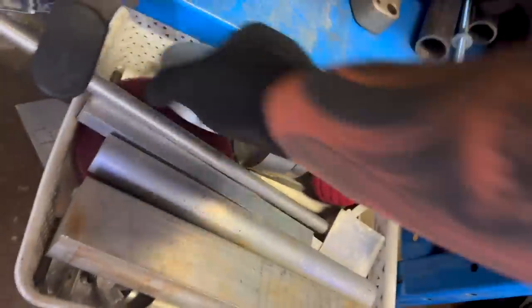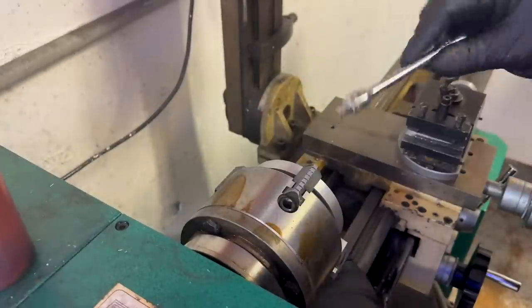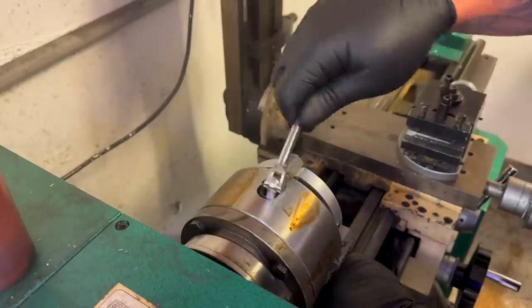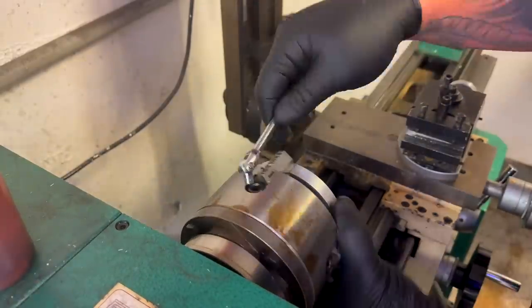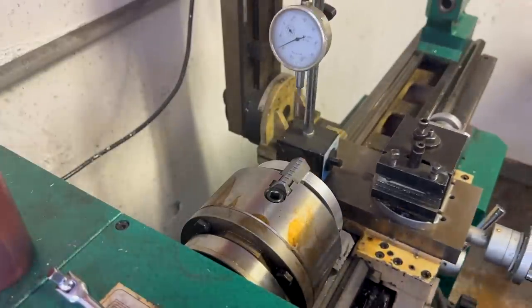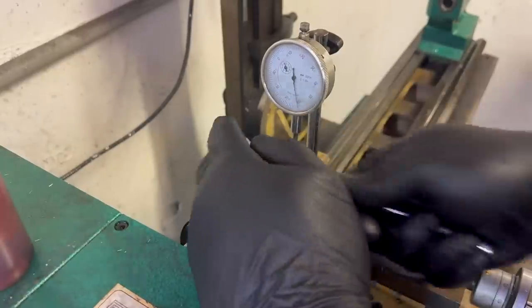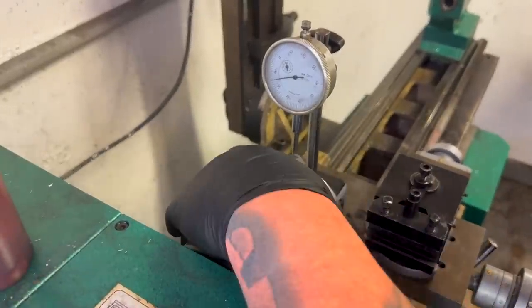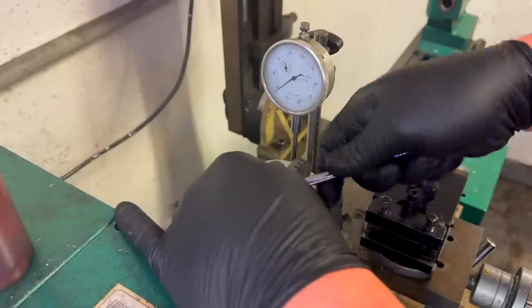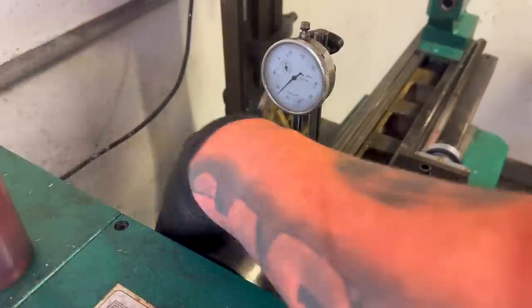What we're doing here is, because we went dry sump, I need to cover up the oil filter side of the block. So I'm sure somebody makes a really nice piece to bolt in there, but I finished the short block and I had a little extra time. Plus I like making things. So I found a 3 3/4 inch chunk of aluminum, and here I'm chucking it up in the 4-jaw chuck on the lathe, making sure it doesn't have a whole lot of run out.